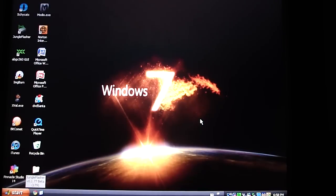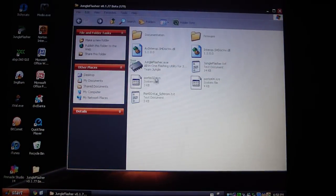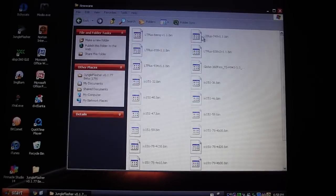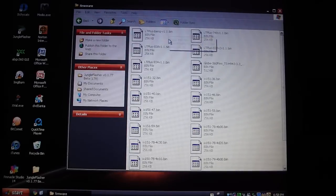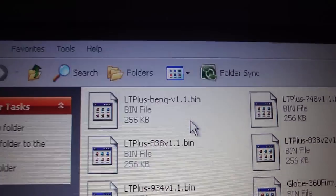Today I'm going to show you how to flash a BenQ with iXtreme LT Plus version 1.1 firmware with JungleFlasher version 1.77 beta. So what you're going to want to do is get JungleFlasher, and then get the firmware. I'm going to put a link in the description for both, and once you download the firmware, just put it in here. See, I have the LT Plus BenQ version 1.1 for the BenQ.